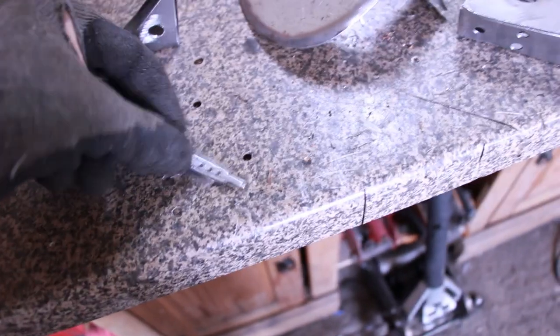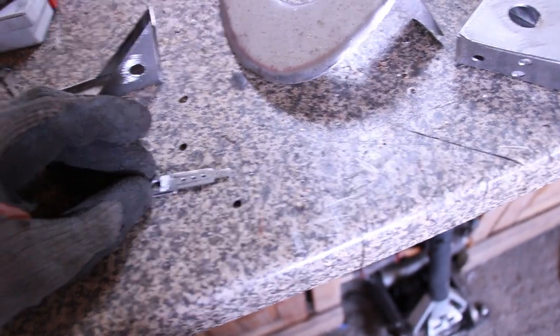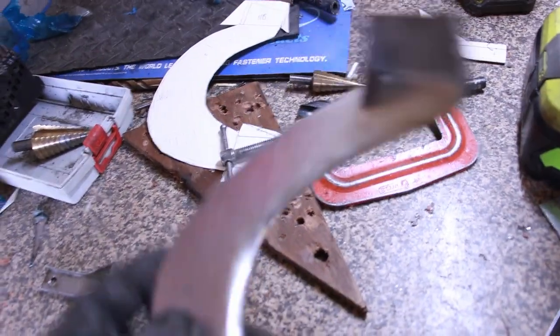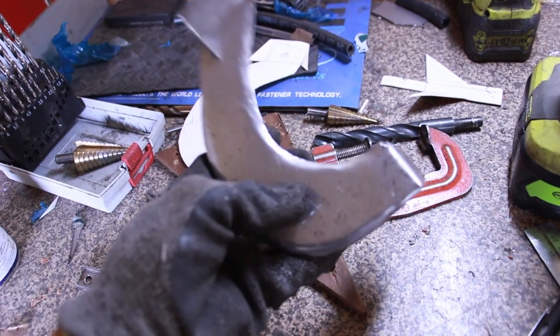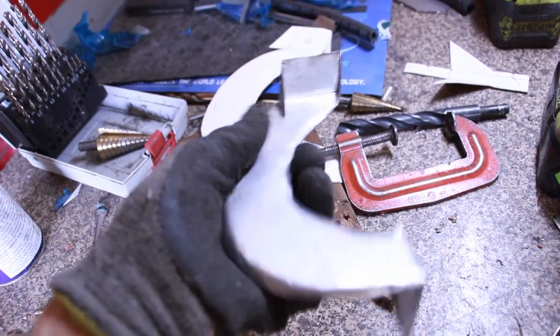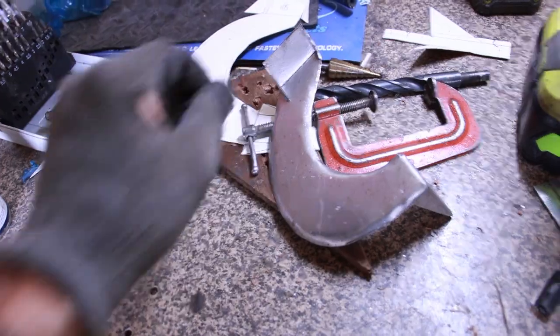Have I worked out how to do that? No, not really. But I'm hoping I can get welds through there. Now weld on there, somewhere on there, and that'll hold the bracket that we want. We bead round each side of that. I don't know if you can see that clearly enough. Gives it a beveled edge, and most importantly, it looks nice. Less things to rub on when they're on a beveled edge, but it really does make a difference on the strength. It's basically like a gusset all the way around both sides.